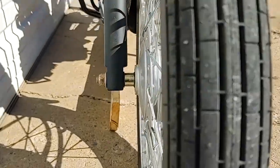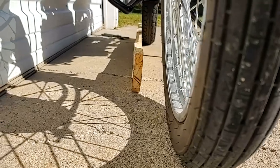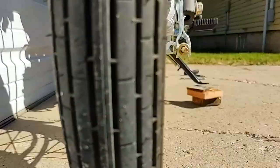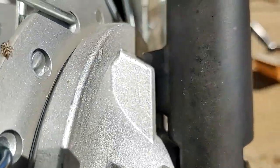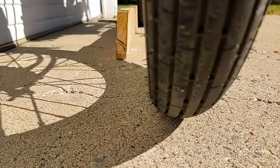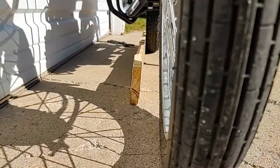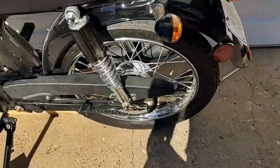Due to the way the wheels are spaced here, the tracks actually are not the same front to back. Like, the wheels are physically off by about 3/4 of an inch. I would move it if I could, but then my brakes won't line up with these tabs and they won't work anymore. However, our alignment stick, I don't know if you can see it with the angle of the camera lens, but I believe we are in alignment now, at least as far as the pivoting of the rear axle goes.